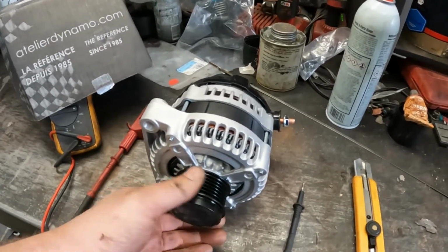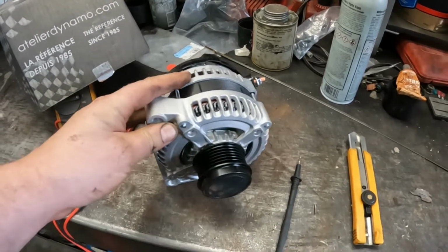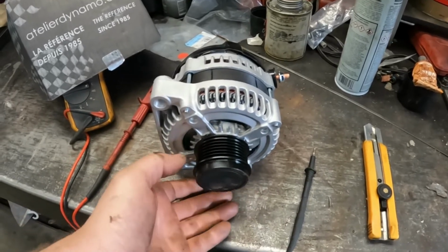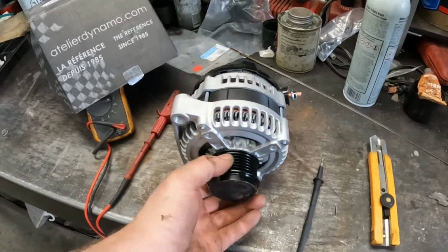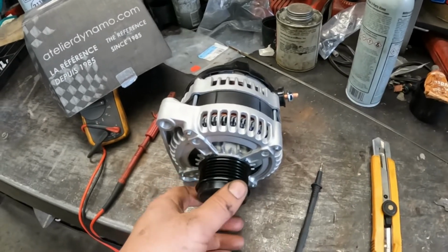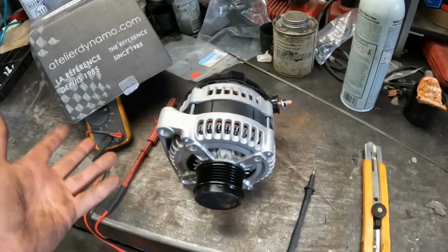But yeah, so these pulleys here are much smaller than the crank, so they spin much faster. You rev up the engine, you get these things spinning real fast. You let off the throttle, the engine RPM drops right away, but this is still spinning really fast, and it'll impart a real jerk on the belt, and then the vehicle is not as smooth. So the idle at least.